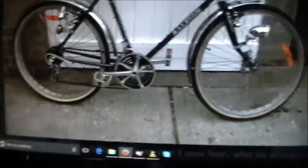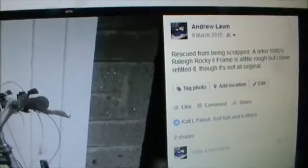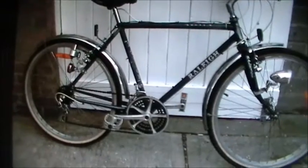So what I did: I replaced the tyres, because naturally the bike had been sitting outside for quite some time so they were knackered. The chain was knackered — replaced that, replaced all the cables, replaced the cantilever brakes, ended up putting an odd pair on the back because this one threaded the pinch bolt. Replaced the gear shifters and brake levers. Most of it replaced with as close to original as I could get. They're the closest I had for the mudguards. Mudguards probably didn't come with the bike originally anyway.